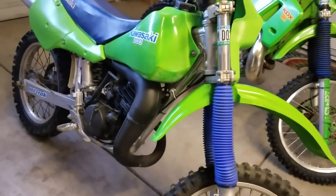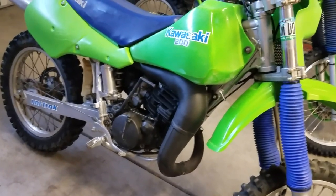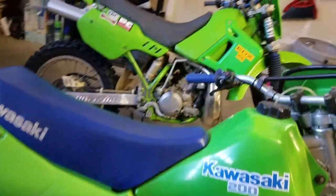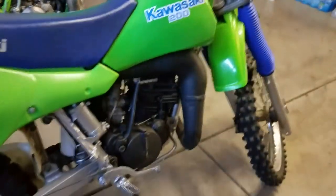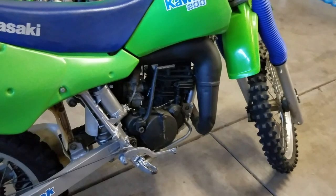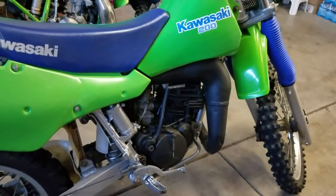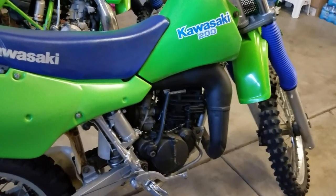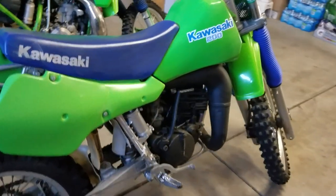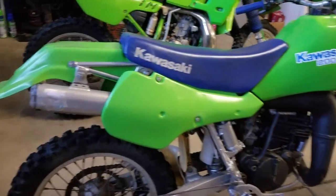These dirt bikes are awesome — it just brought back memories. I went dirt bike riding a couple more times with my dad and it was just fun to get back on this bike again after all these years. I just cleaned out the carburetor, changed the oil, the spark plug, air filter, put some fresh gas in it, and just kicked it probably eight or nine times and it fired right up and was idling — like it was running the day before. It's crazy, these bikes are so reliable. You can just count on them. They're just incredibly well made dirt bikes.